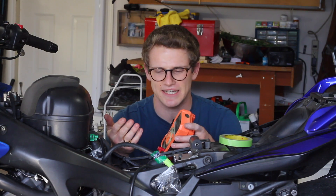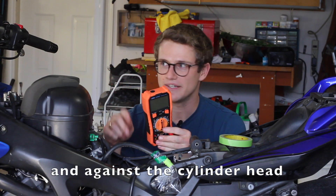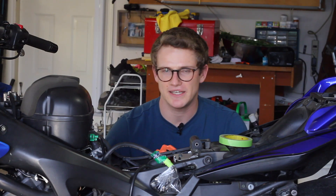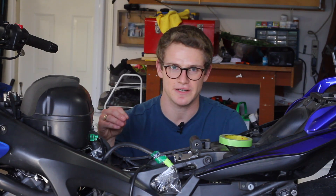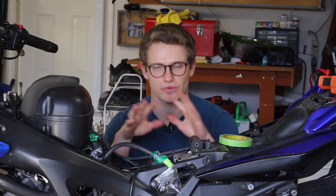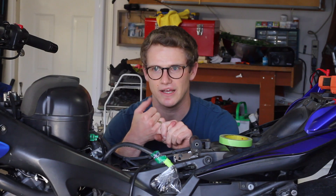I don't want to take the sensor out of the bike, so what I'm thinking is we'll get the bike up to 80 degrees Celsius. I know what you're thinking — if my temperature sensor doesn't work, how am I going to know it's at 80 degrees Celsius? I recommend you invest in a multimeter that has a temperature probe. I'll connect my temperature probe to my multimeter, hold it in the radiator, let the bike get up to 80 degrees Celsius, shut the bike off, then go in and probe the sensor as close to 80 degrees as I can get. The only other idea is using the weather to your advantage — if you live in a cold climate and can get the bike close to 0 degrees Celsius, you could test it in those conditions. The reason I recommend not taking it out is because you need a crush washer to seal the coolant temperature sensor into the back of the cylinder head, and that can be a pain. If we're in the ballpark of the spec for 80 degrees, then we're good.